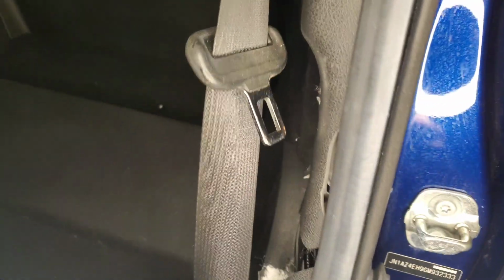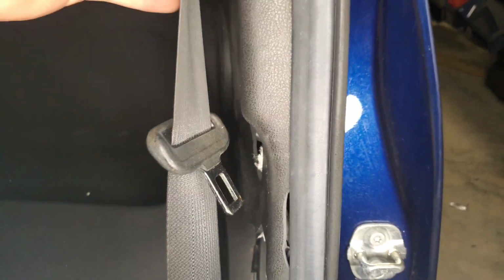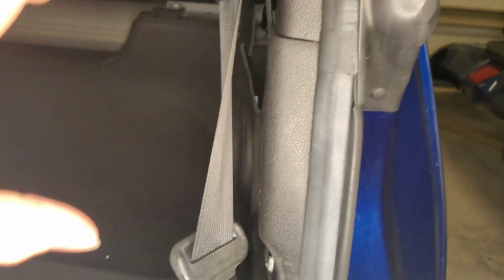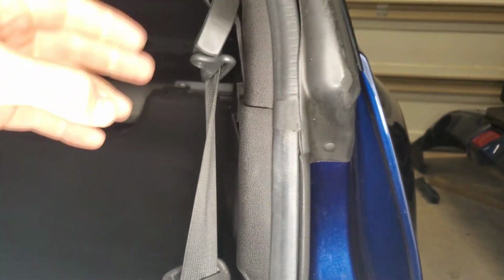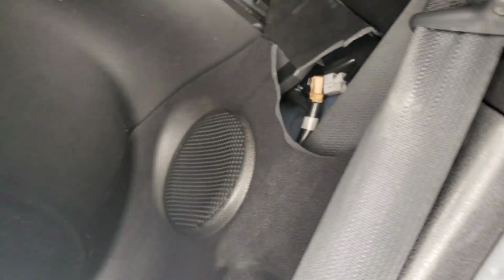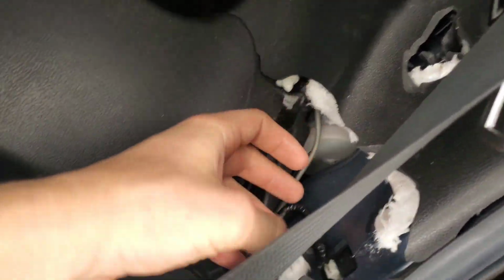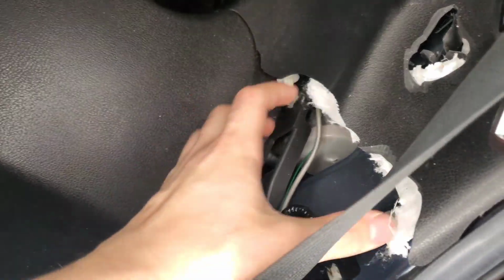Now, as for the seat belts, they also tighten up whenever a wreck happens, and if any airbag deploys, the seat belts will become tensioned and they will not let go because like a little charge goes off. So this seat belt was so tensioned it managed to break this plastic here. And then I don't know how all of this broke, but it also broke.